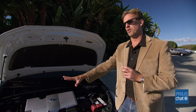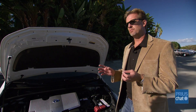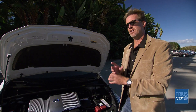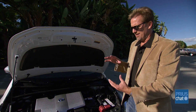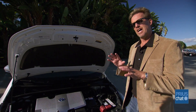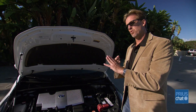There is a new rating system in Japan that we're going to adopt with other Japanese manufacturers on how to determine power output on these blended-type drivelines. In the case of the old car, we simply took battery horsepower and gas engine horsepower and added them up. But the reality is, when these cars are operating, that very rarely happens — and in fact, the tuning on our new car is such that it doesn't really happen at all. So we have a new blended average way of estimating horsepower. It is a new testing and rating method.